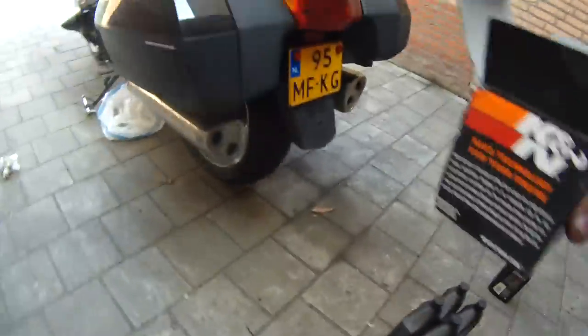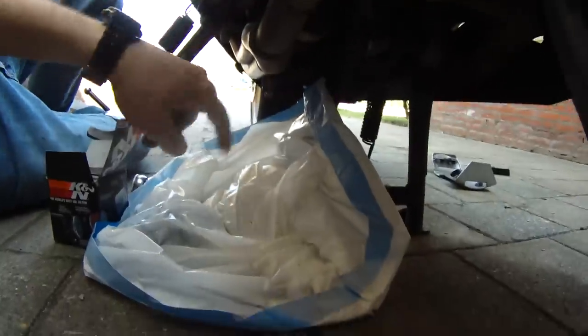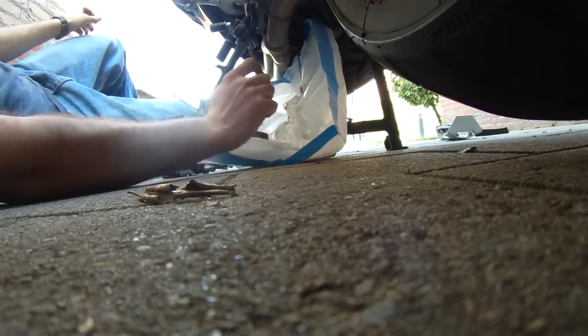Now that this is ready, I'll go ahead and get this ready to swap out as quickly as possible so I don't get oil from the old filter all over everything. That went relatively well. I don't see any more oil in there, so the filter has soaked it up, which is good. Oil filters only really need to be about hand tight, but with that bolt on the back it makes it a little easier to get those final couple of tightening turns — just don't tighten it all the way down or you won't be able to get it off next time.